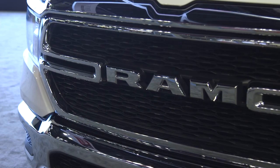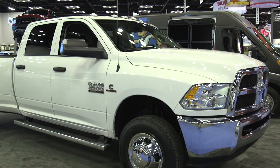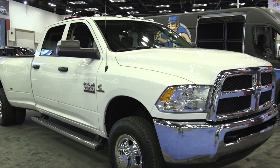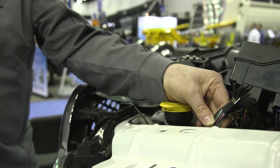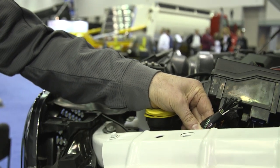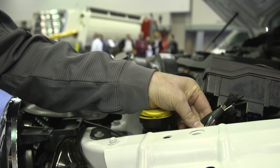Probably one of the key features that we're most proud of is what we call dedicated snowplow lighting wiring. The reason that's so important is the snowplows essentially try to emulate our lights. In other words, when you plug the snowplow wiring in, our lights turn off and the snowplow lights take over. In the olden days, that was simply done by tying into our wiring.